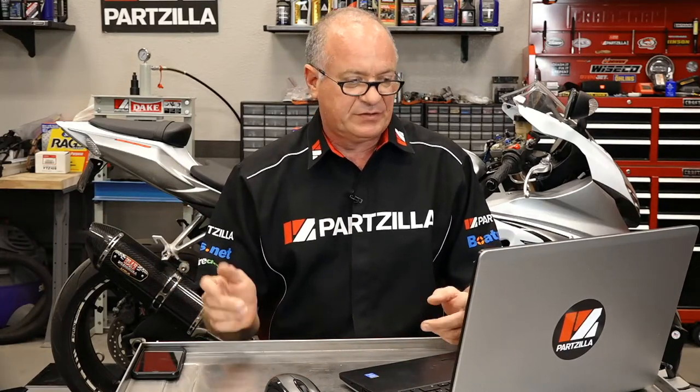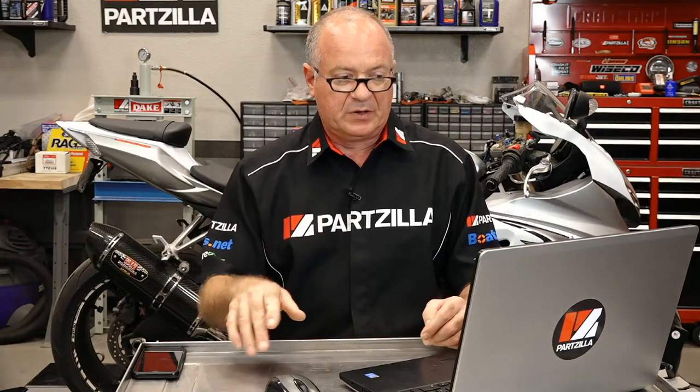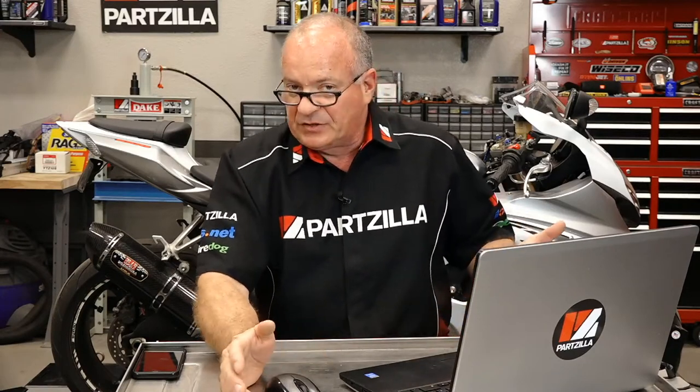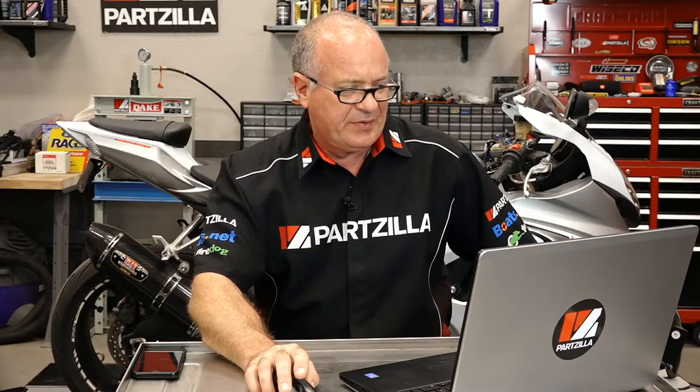And all of that is getting passed through all those passages, and the oil cooler is one of them. So I would think every 5,000 miles on a sport bike would be a good time to go ahead and take it out, flush it out, and then refill it with oil, get it primed, and then reinstall it. But that's just my personal opinion. Oh, he did tell me it's a 2015 R6. Go with that 5,000 mile rule.